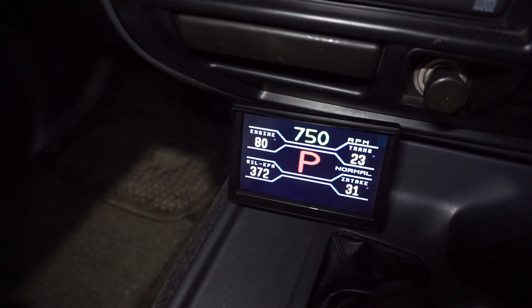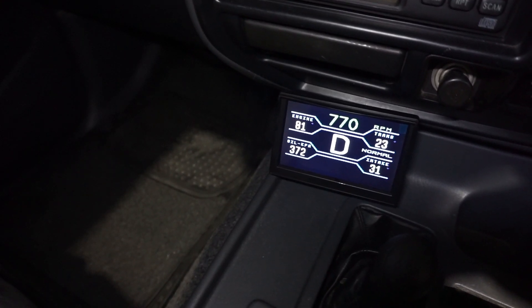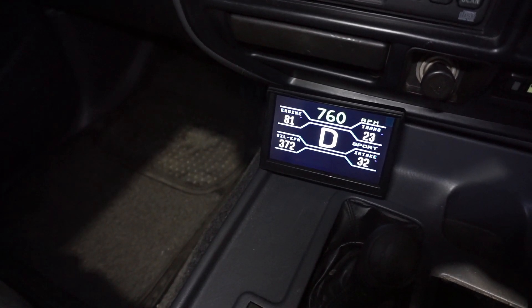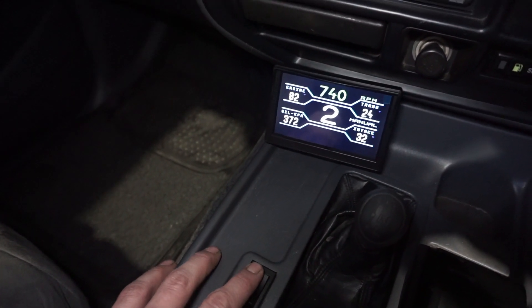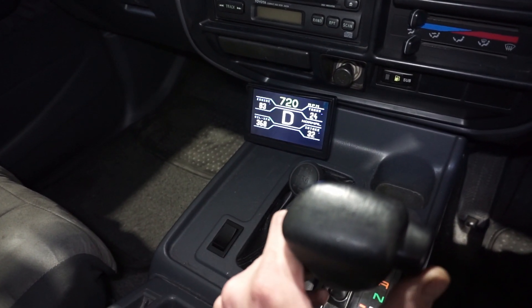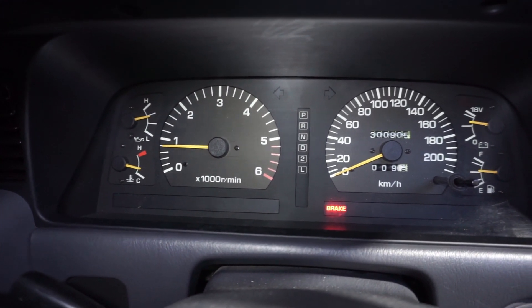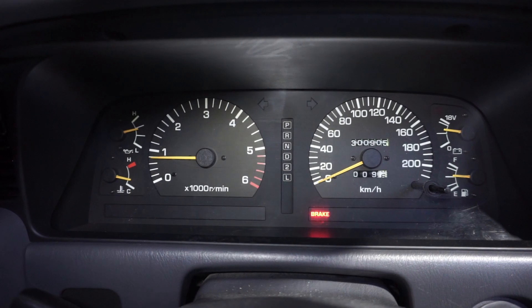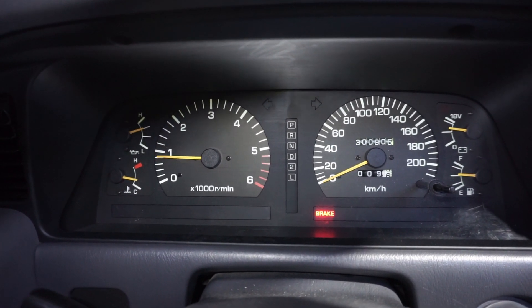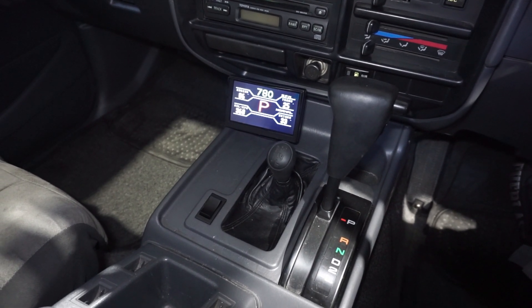Back on the inside of the car — you can see on the LCD screen we've got our tacho and all our temps. When I move the gear selector you can see it change on the screen. We've put it into sports mode and we can select what gear we want from the switch on the side of the console. We can take it out of manual mode by just hitting the overdrive button on the side of the shifter. Looking at the dash you can see coolant temp and oil pressure working along with the tacho. The speedo runs off the transfer case loom so that should work, along with the battery and fuel gauge.